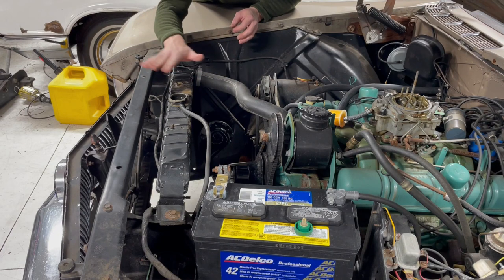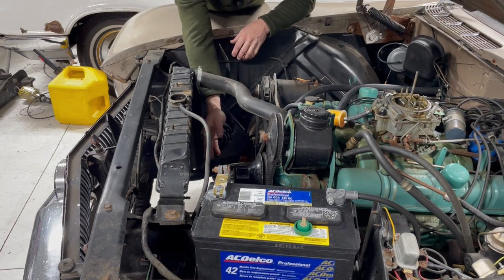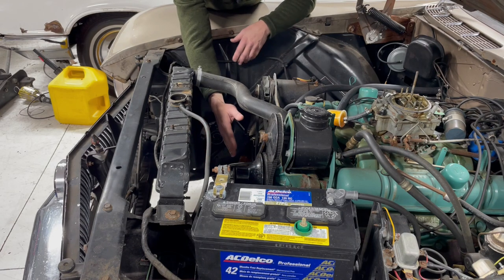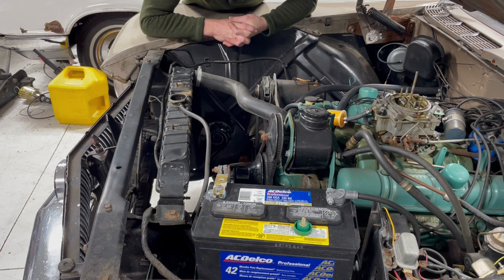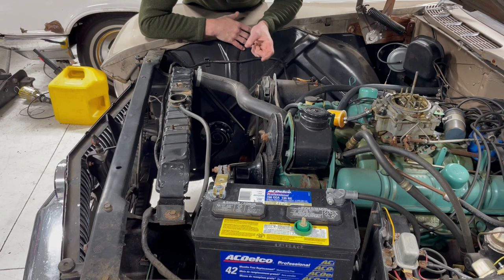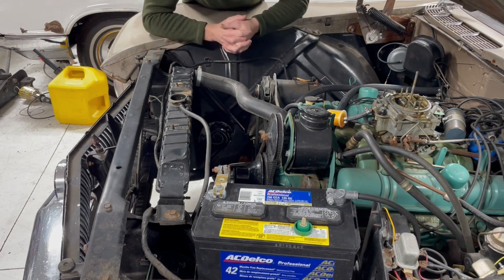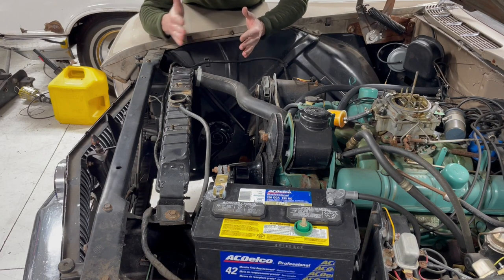While this thing is simmering, I think we're full, but I want to touch on the proximity of the fan to the radiator again, since this thing doesn't have a shroud. It's super imperative for it to be as close to the radiator as possible to eliminate any bleed or lack of efficiency using the fan. I was just under 3 inches, maybe 2 3/4 away from the radiator on the clutch. So I ordered a 2-inch spacer, which will bring us 3/4 inch away from the radiator. That should get us as close as I feel comfortably possible, and it gives us a little wiggle room to get the fan on. Also, if there's any flex or deflection in the fan, it doesn't eat into the radiator.